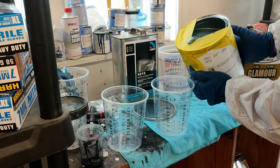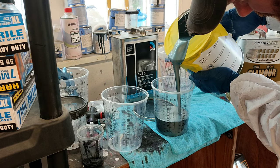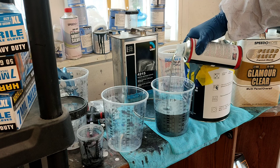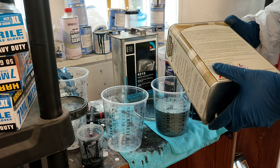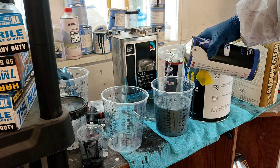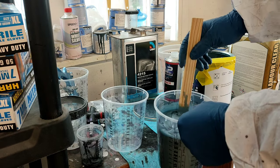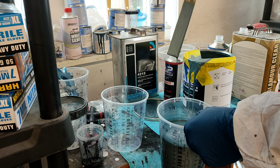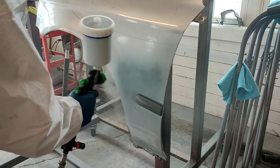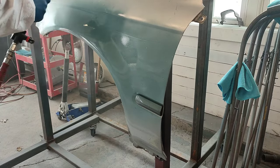Now, if you're going to attempt to spray single stage with metallic, you definitely want to watch this because I am going to play a little bit of bench chemist here. You almost have to play bench chemist to get the single stage metallics to lay out good — they are very hard to spray. We got our paint in there, throwing in our hardener. Next, you can add show quality clear coat to any single stage to increase shine, so I added a little bit of glamour clear coat. Now we're adding in our reducer. You want to make sure this paint, once you mix it up, starts dripping off the stick within three to four seconds — around three is better. That is what's going to give you the best result. Also added a little bit of base coat activator to increase the durability of the paint. Now when attempting single stage metallic, you must set up a spray panel — test it out, make sure it looks good on the panel before you put it on the car.